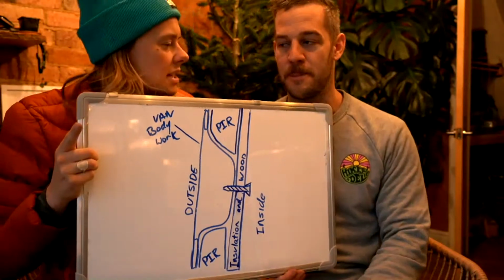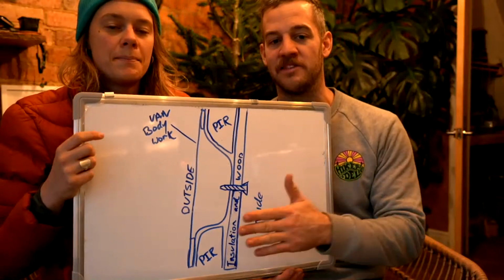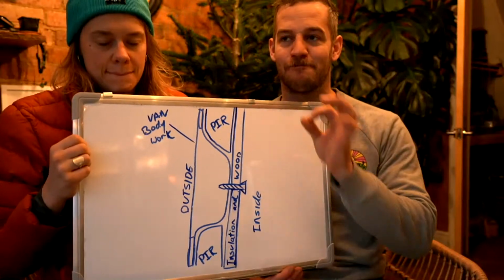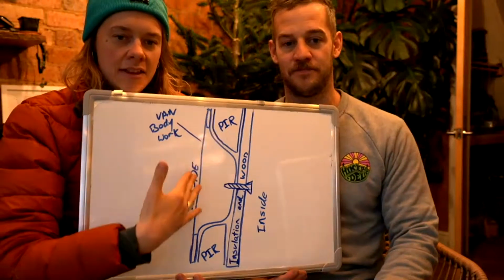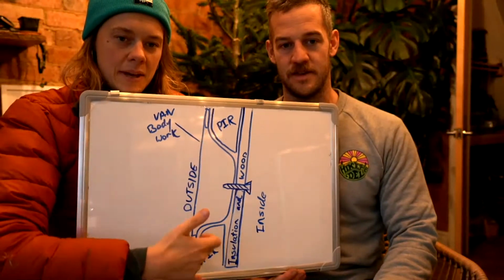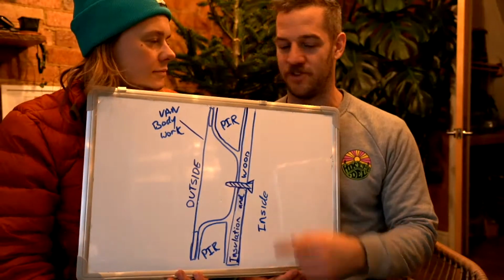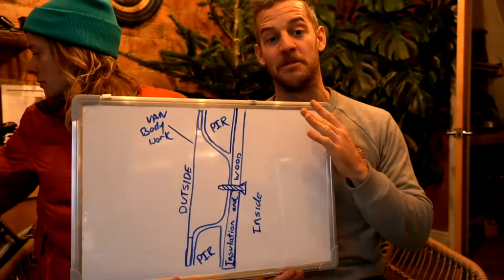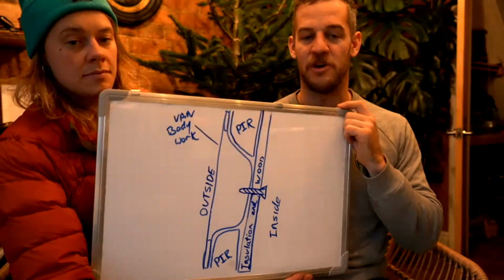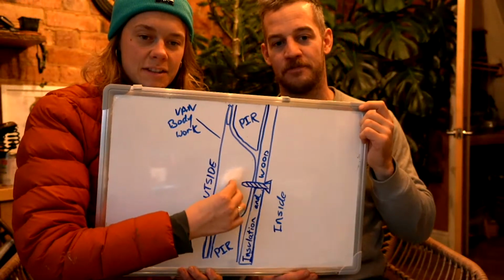If you've done it, don't take it out. Yeah, don't. It's not worth the time. Whatever thermal properties there are is absolutely minimal. So outside of the van, this is the metal rib ceiling bit, PIR board. Yeah, just don't waste your time. This will be good for when you're pushing between PIR board. So don't feel like you have to stuff this bit in here, basically.